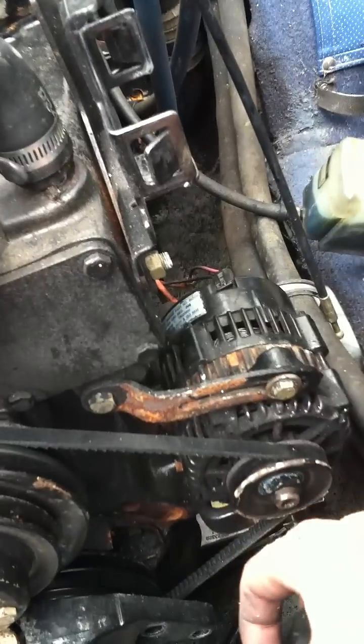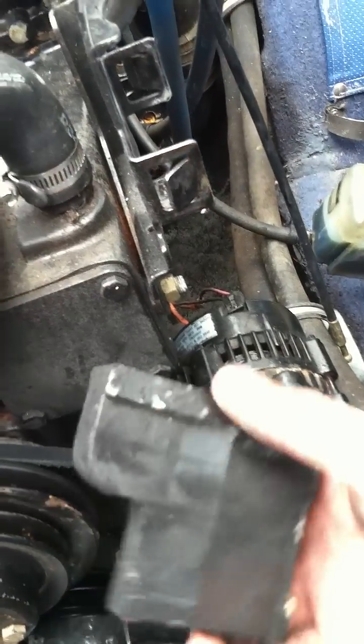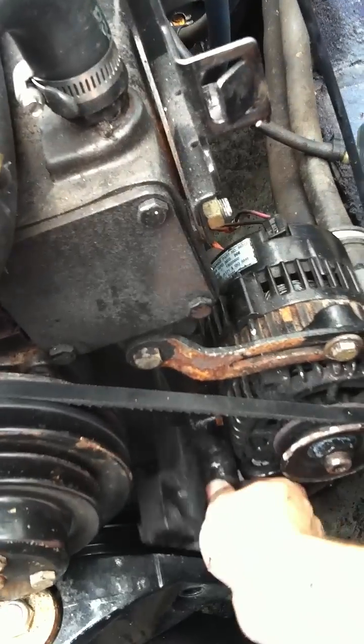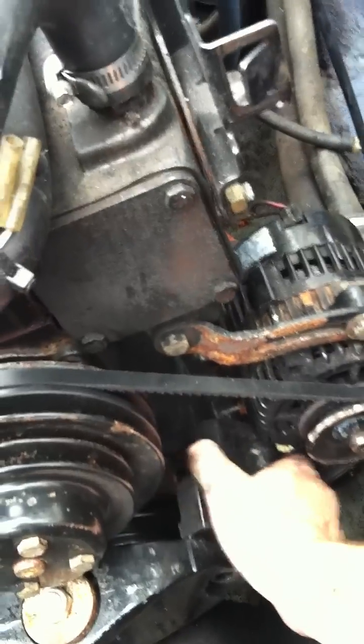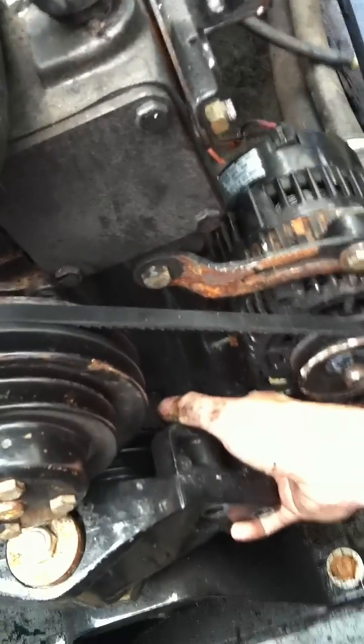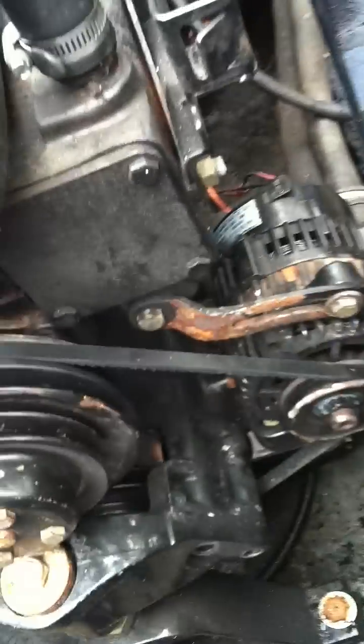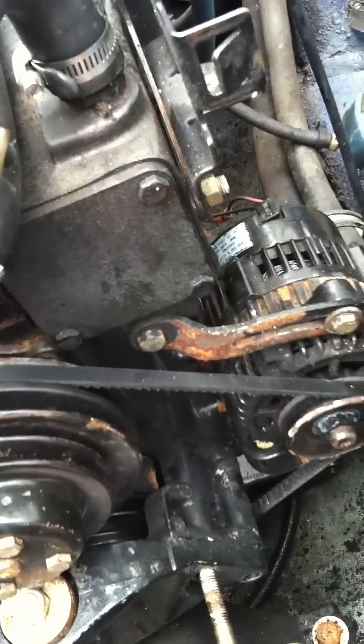I've seen a lot of questions on what to remove for the spacer to get this thing onto the pulley without having to do something funky with the mounting brackets. That spacer is this guy right here, and it just fits in there like so. What I did is I put a little scissor jack underneath the engine and pumped it up a little bit just to keep it in place, and these bolts pop right back in there.